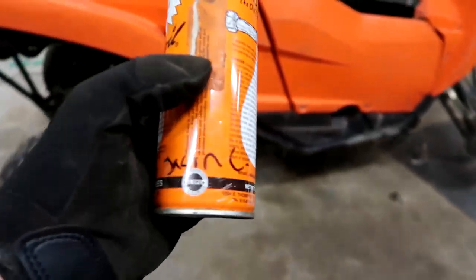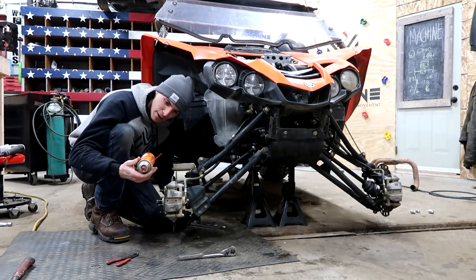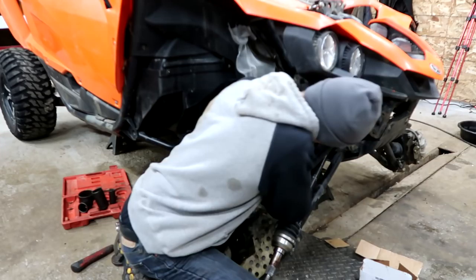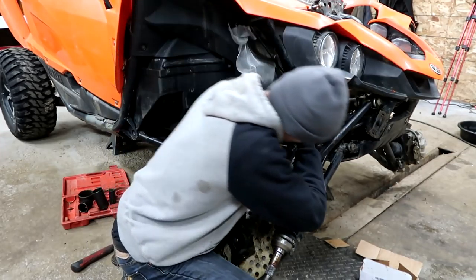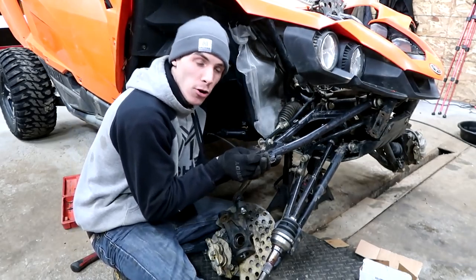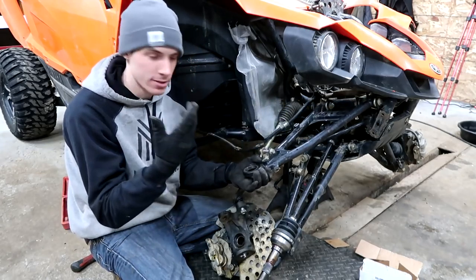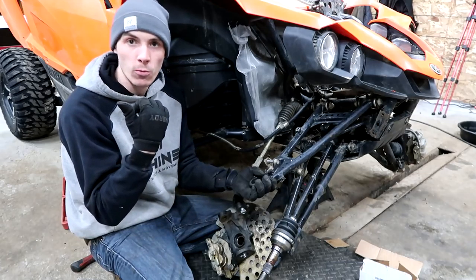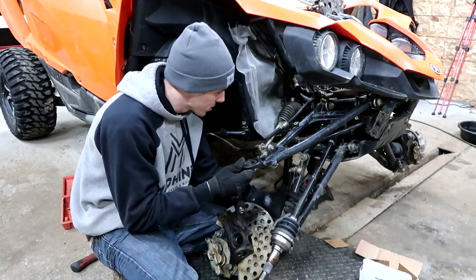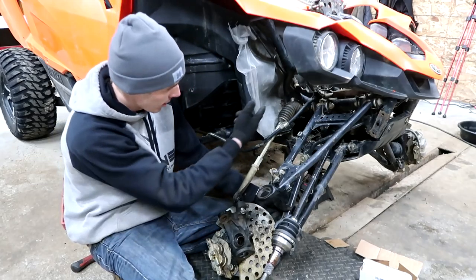Thanks Jason, I'm still using it. It's awesome when I can shout out a machine freak for helping me with the job. This stuff smells fantastic. Check out this upper control arm — there's no play at all and it works exactly how it's supposed to. I really don't want to replace this because it's not bad, but those new ones are way stronger. This lower control arm — you can just hear it. It's not so much the front, it's the back pushing, and I'm sure it's like that on the other side too.